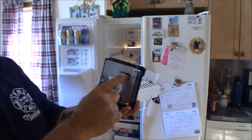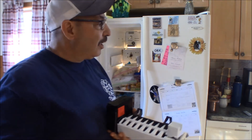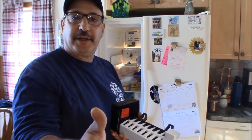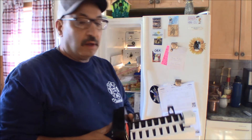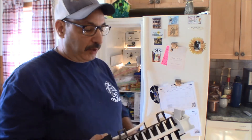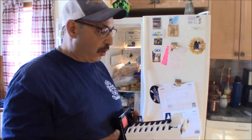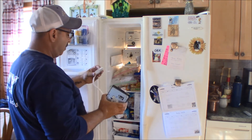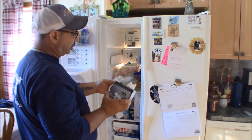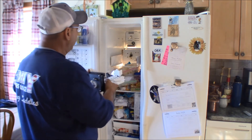This adjustment looks exactly the same on the old one, so I'm going to leave it at the factory setting since it worked fine. There's a decent amount of ice in the bottom without a big chunk, but we wanted to replace it anyway — the thing should have been full and it was very slow working. So we're going to plug this in. You just slide it in, plug the harness in, this little plastic cover covers the connection, and tighten the screws down. Then turn it back on — off is this position, on is this position.